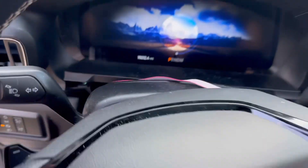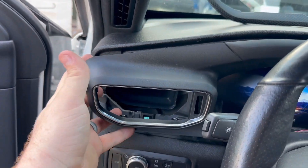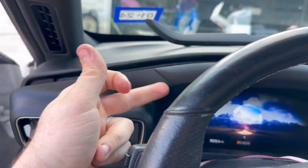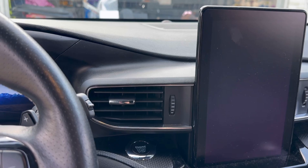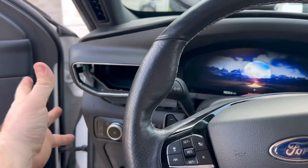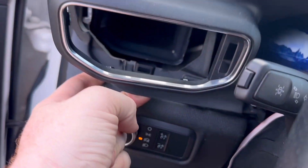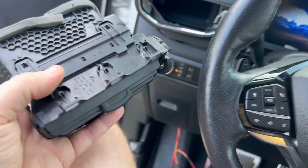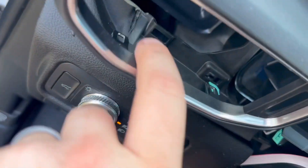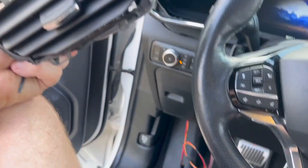So as we're sitting in here, you can go ahead and pry up this piece to get it loose. Then with your trim tool pull behind here and this whole piece will pop out. Now I think it's really dumb - I feel like Ford should put a split here but there's not, it's all the way down here. When you try to get it down here it goes way over here so you're gonna have to undo all that. I was like I'm not doing all that - it's just getting excessive, having to pull half the dash to get to this thing. So I was able to access what I needed over here. I went ahead and pulled out that little carbon trim from under there so I wouldn't scratch it. From there I was able to pry out and actually get the whole vent to come out. You're gonna have little tabs here - two down here and three up here. You literally just use a little flat head screwdriver to get underneath those tabs, pry up, get the top undone, get the bottom undone and the whole vent should slide out.